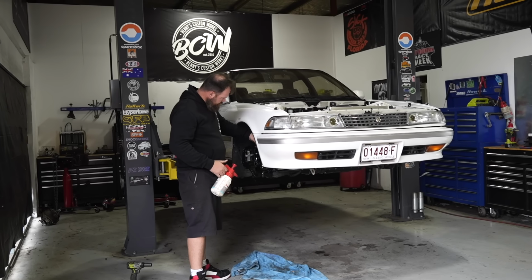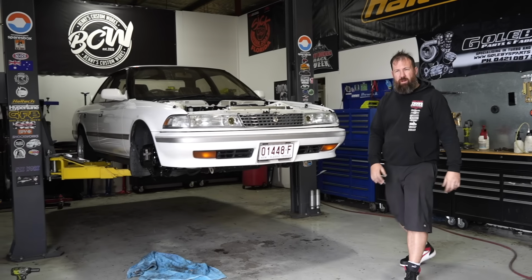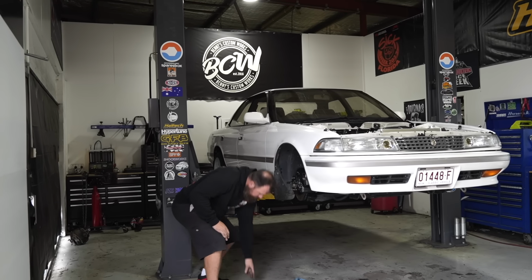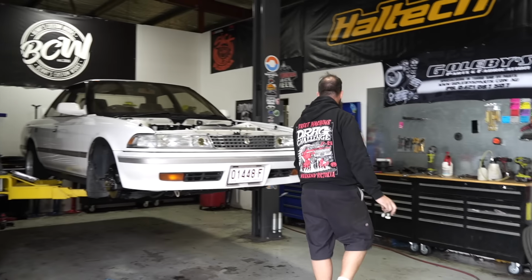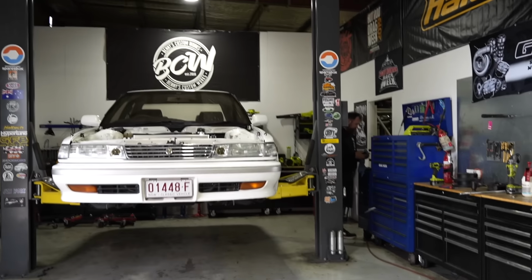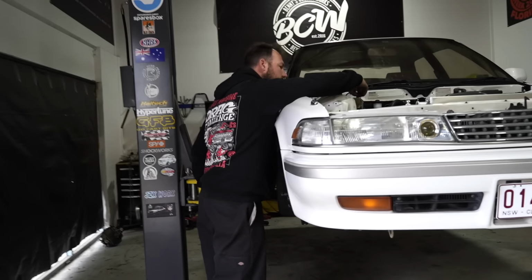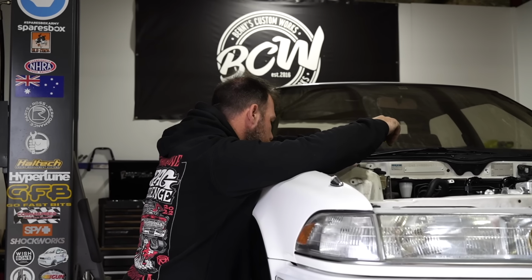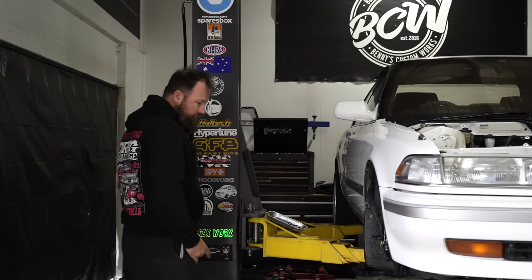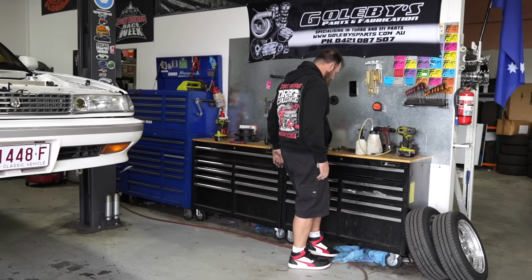Pretty sure I discussed this with you last time, but I thought that you weren't able to crack the nipple without it sucking in air. Well, there should be no reason why the system's under vacuum, so I think that's a bit of a wives' tale. And how come people sometimes will have the hose going into a bottle full of liquid? Is that just because they're pumping? Well, yeah, but also, if the hose is submerged in liquid, it's never going to draw air either. So it's more just a safety thing, just in case? Pretty well. Especially if you're pumping the pedal, I guess, because by pumping the pedal, would you potentially create some sort of vacuum? No, it shouldn't. Well, when you come off the pedal, technically it could suck fluid back. But because we're not pumping the pedal, there's not really much risk of drawing any fluid back. Or drawing air back, I should say.